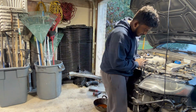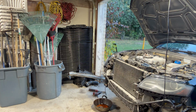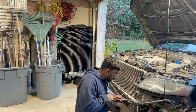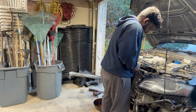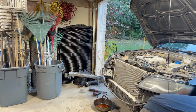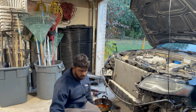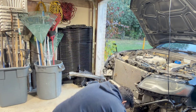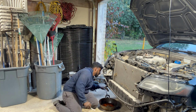You see here, this is me struggling with the AC condenser. That plastic piece did not want to move at all. It just kept getting stuck and jamming, and I'm struggling over there, you can see. But once you essentially take it off, the 2 long steel pipes actually run to a soft flex sort of line, so you're able to take it off and move it completely out of the way. That way it doesn't invade your space, and it's easier, so you don't have to drain the Freon or anything like that.